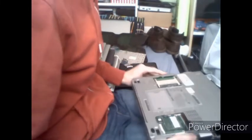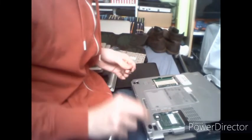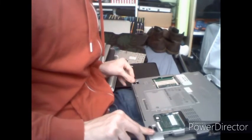Once it's in the socket, once the screen is mounted in its little positioning areas, close the screen and secure the panel from falling out by inserting its two little screws that we found hidden under the hinge covers earlier. Sit those here and here. Flip the computer upside down and insert the two screws which are marked LCD on the bottom.